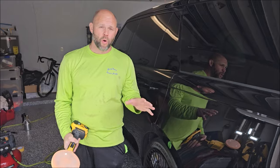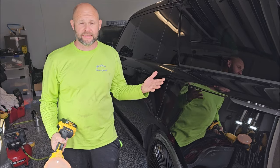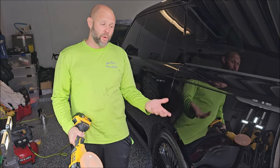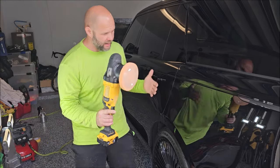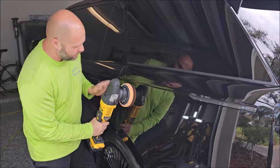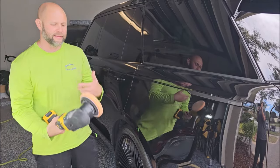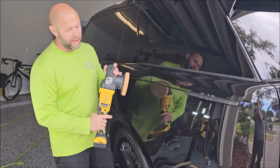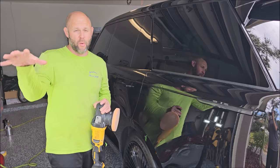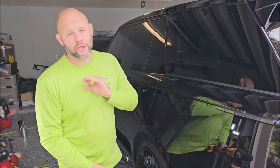Now, I will be doing more demos for you guys in direct sunlight. It's going to be about 70 degrees today, it's overcast. For two pea-sized dots, you can literally do this whole rear quarter panel. How I generally do it is I'll push it around like that, spread it around the whole panel — I let the polisher do all that. My buffing cycle is the same with this polish as it is with my water-based polishes: I do three passes for a section pass. Wipe, done.